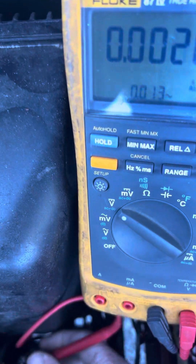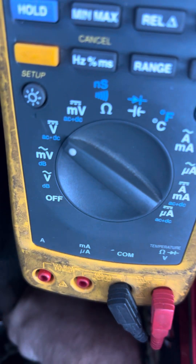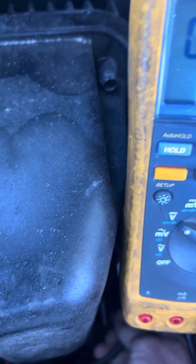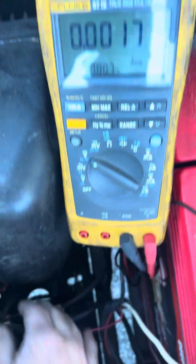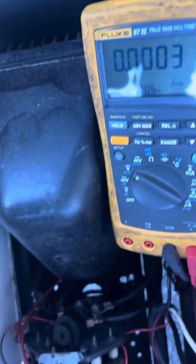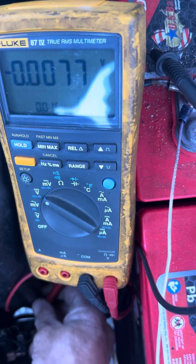All right, I'm going to reverse. So all I want to show is the battery voltage at the bottom post. What that means is the voltage is not transferring — it's coming from the solenoid going to the forward/reverse board, but it's not transferring through the board on the top post.